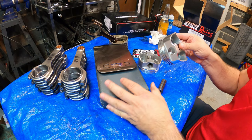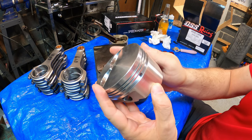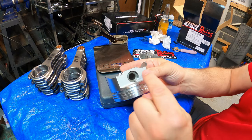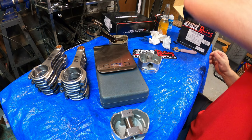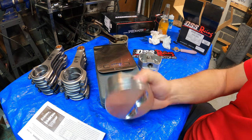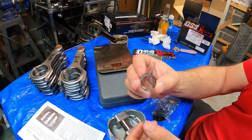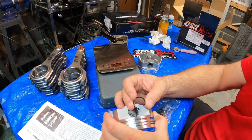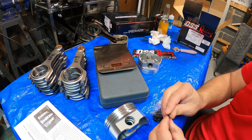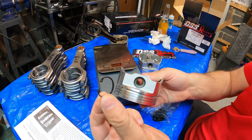Out of the box, the machine work is fantastic. The pins fit beautifully in there. You can have optional spiral-lock clips on this. These are the E-series pistons, which is their entry-level forged piston — plenty for what we're using right now. It comes with standard E-clips, which clip in here. The spiral locks are a spring-type clip, and what's really nice about this piston is that it accepts both spiral locks and these standard locking clips.